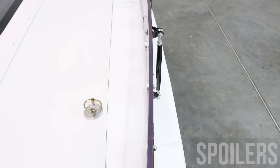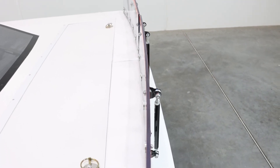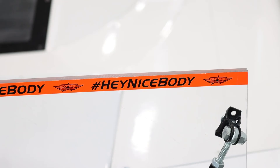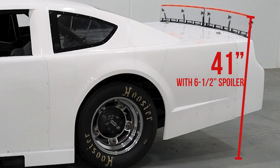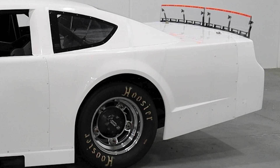Polycarbonate spoilers must be mounted on the front side of the spoiler base and must maintain the same contour as the bumper cover. Spoilers are available in 6.5-inch tall by 60-inch wide and 5-inch tall by 60-inch wide options, with the available options determined by the sanctioning body. The maximum width of the spoiler is measured across the rear of the spoiler. The maximum height of the top corners of the spoiler — left and right — is 41 inches for a 6.5-inch blade and 39.5 inches for a 5-inch spoiler blade, with a deck lid at the correct height.